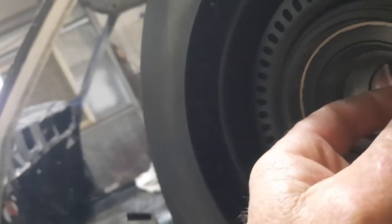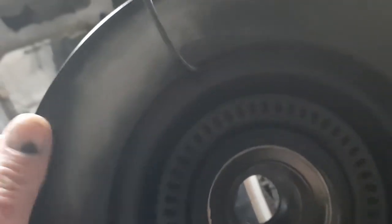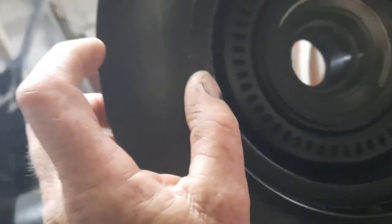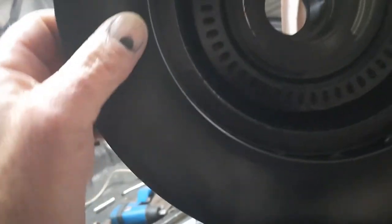For the rotor surface here, don't worry about having paint on it and don't bother masking it. I've just lightly sprayed around the edges, not concentrated on the middle. The first time you brake, the pads will chew that off — it's not an issue. It's actually better not to mask it, because the pads don't come to the full edge of the machined area. If you mask it or wipe it clean, you'll still get rust either side of where the pad runs. By leaving the paint and letting the pad take it off, you won't have any area going rusty.